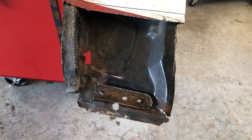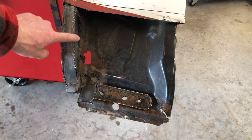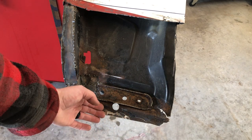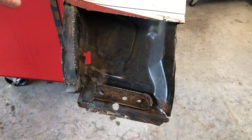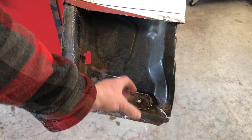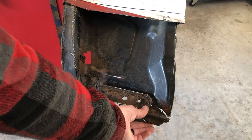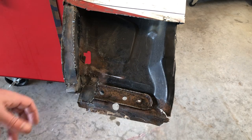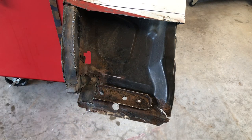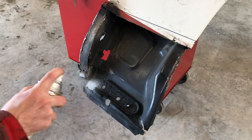It's a work truck revival, not a work truck restoration. Now, this part down here I'm really leery about cutting out and fixing, because my metal fabrication skills are subpar at best, and I really need this lip to fit correctly so that I have something to butt weld to, because that's an important piece for the bottom part of the patch panel. So I know I'm going to get a lot of flack for this, but I think what I'm going to do is just leave this part alone and use some rust reformer to convert that rust to metal, seal it, and throw a coat of primer over it so it doesn't rust anymore. I'd really hate to mess this piece up and botch all the work I did here. So we'll get some rust reformer on this and get rid of some of the surface rust, get a coat of primer on all this, and then move on to the fun part — fitting, cutting, and installing our patch panel.